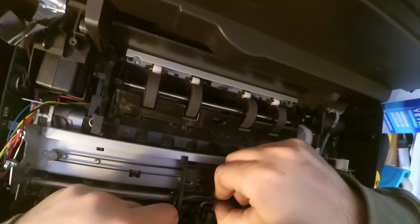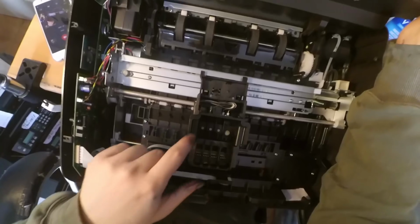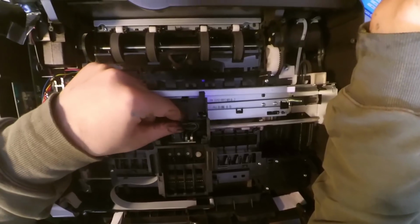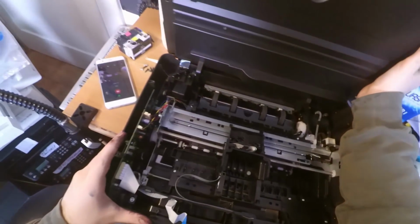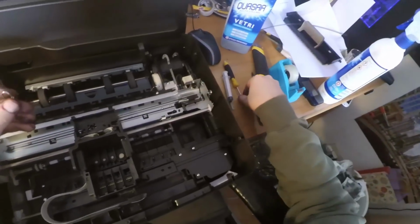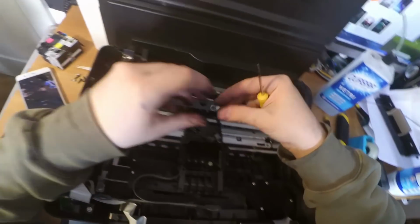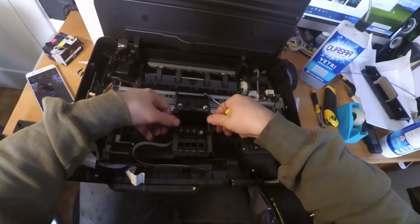The printhead has been inserted properly, and be sure to check that this ferromagnetic piece that holds the flat cables is positioned properly, like it's not in this case. Okay, so like this. And let's reconnect the springs. So we'll take the same really little screwdriver, and I will reconnect the springs. Okay, so now the printhead has been mounted.